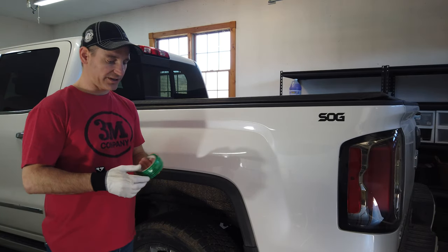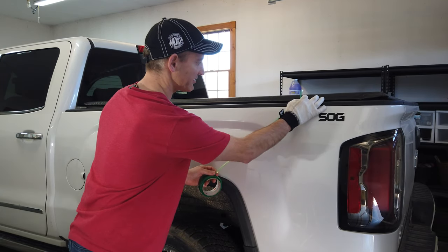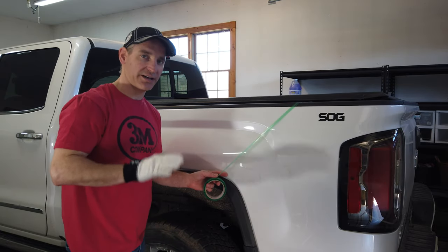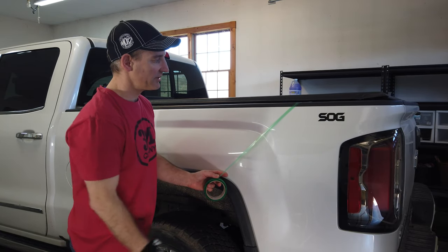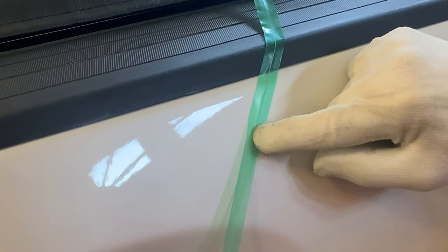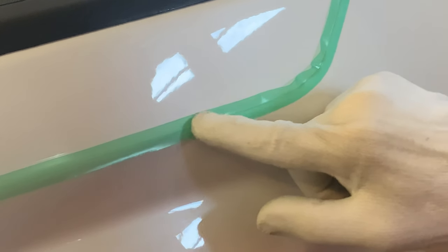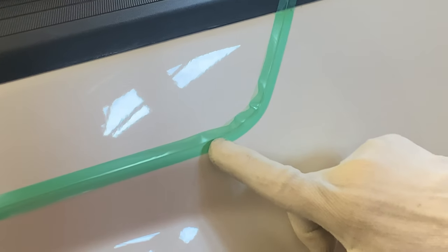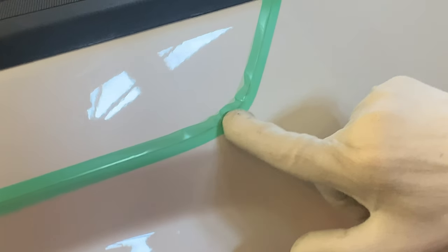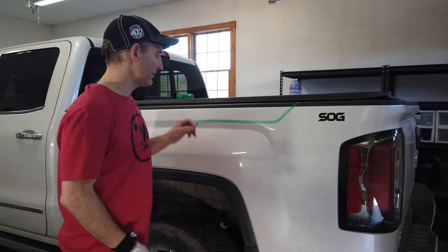I'm going to show you with the 3M bridge line knifeless, and the reason for that is it's thicker — if I can turn the bridge line at a sharp turn, we can turn any of our tapes sharp. You're going to take this, and as you're turning it, you're going to lock down the outside of your tape, and you're not going to put that tension I was showing you earlier. Notice how the inside has buckled — that is fine, because if you lay down your knifeless, you can see that the filament is still good. So that's with bridge tape.